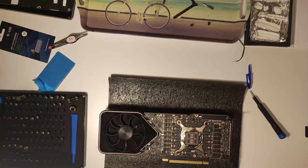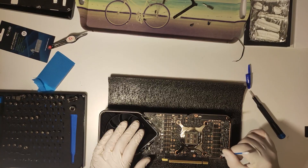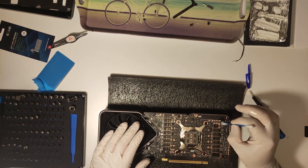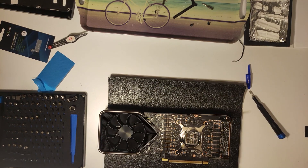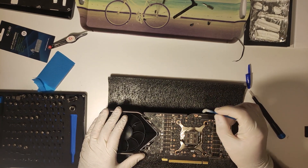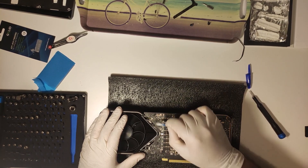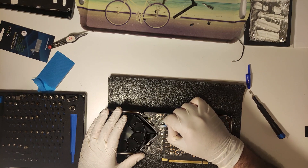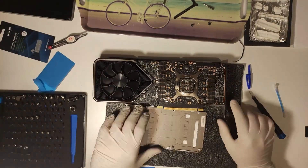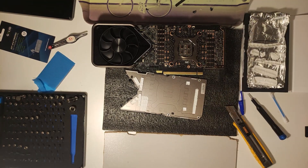Pop the GPU into your machine and run something very demanding — like Cyberpunk on Ultra 4K, Heaven benchmark, or 3DMark — to holistically stress your card. You should stay under 80C on the memory (in my case an improvement of about 26C), under 65C on the core, and under 75C on the GPU hotspot, as measured using HWiNFO64 or GPU-Z with the fan set at 65% constant speed in a 21C room. If the GPU and memory temperatures are both behaving but the GPU hotspot goes over 90–100C, stop the test as you need to do some fine-tuning. Do not despair — you did not break your GPU. Don't rush to eBay to make it someone else's problem; it's actually a very simple fix.